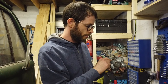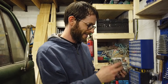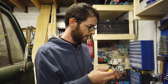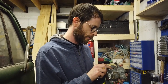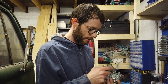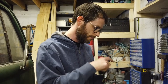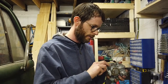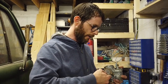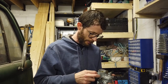this whole thing moving along with this. I think this is probably why this was taken off the car, because its choke is not working. But yeah, they do break. The mechanism does break sometimes. The spring can get warped inside there. So you can usually find replacement parts, just these top parts, to fix it. It doesn't want to move, but I know for a fact the one in the van does move, so we're okay there. We'll be able to adjust it.